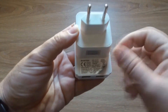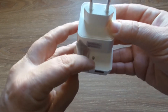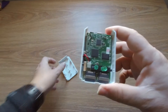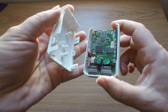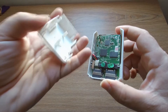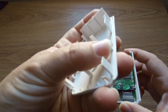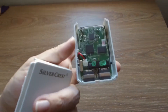The only thing we need is this screw — let's unscrew it. You just have to be careful to remove these clips here, here, and here, and we have the main board.